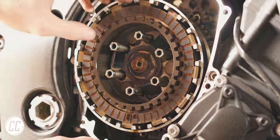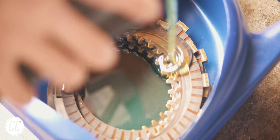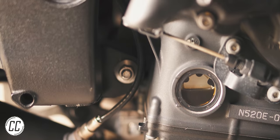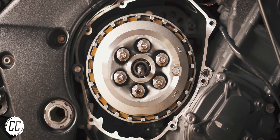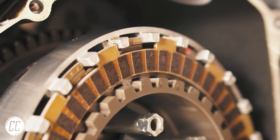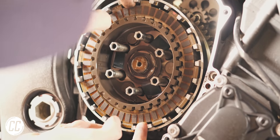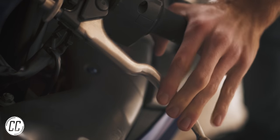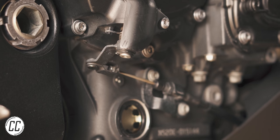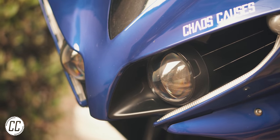Today we'll fix that by removing the clutch plates from the basket and soaking the friction plates in oil overnight, in the order you removed them. With the bike on the side stand you shouldn't even need to drain the oil, because the oil level will be below the clutch cover. Friction plates require soaking in oil before installation to saturate the friction lining — they can dry up if the bike sits for a long time, and this just might reinvigorate your clutch's will to do clutchy things.